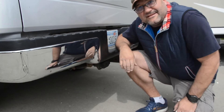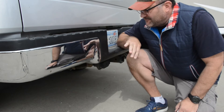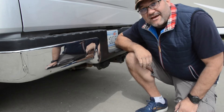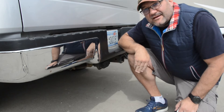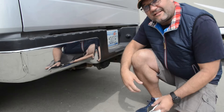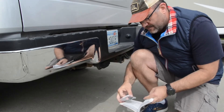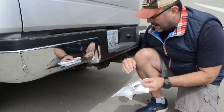Today we're going to talk about something I'm frankly a little embarrassed I didn't realize was happening the past four years towing with my F-150. I have had no 12-volt power going back to my trailer. Doing a little research, I discovered that in my glove box the entire time there's a relay and a 30-amp fuse needed to get 12-volt power to the trailer.